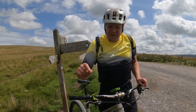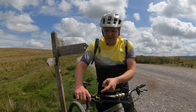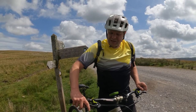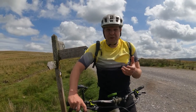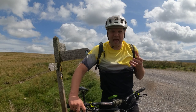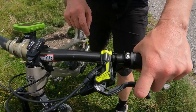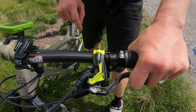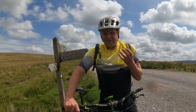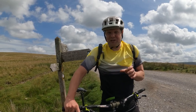The reason I like Magura brakes is how they actually work. They have a little bit of a spring to them and a fair bit of what they call free stroke. This means my hand can rest one finger, and when I'm on the brakes I can feel the lever push back. It gives me a really strong sense of confidence that my brakes are there when I need them. And then a very, very tight bite point — you can feel the brakes catch — and then loads of modulation after that. You've got that constant feeling they're there for you, a bite point so you know they're working, and then loads of modulation.